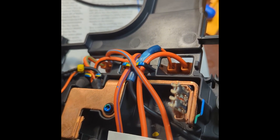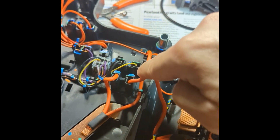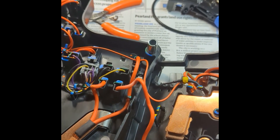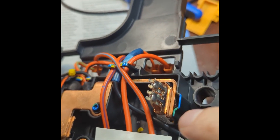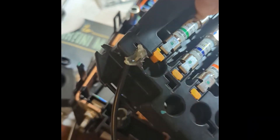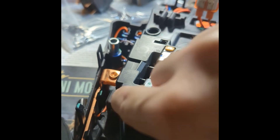What I finally settled on - even though it's not ideal but it's the best I think I can do - is the positive of the charger still goes through that fuse and through the charger contactor, so that's still switched. But the negative I'm just going to wire to be always connected to the negative. Again, not ideal but it's the best trade-off I came up with. That wire runs inside all the way through and I just dremeled a little hole for this to come through.